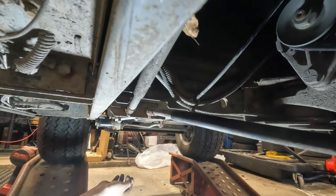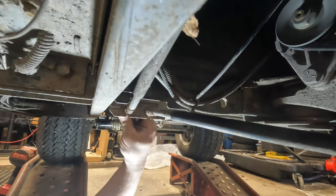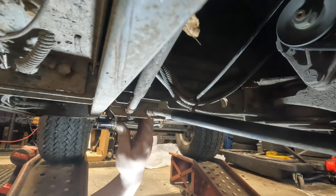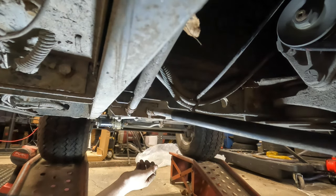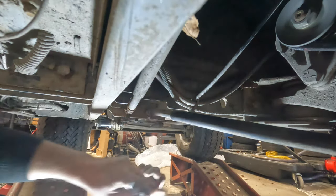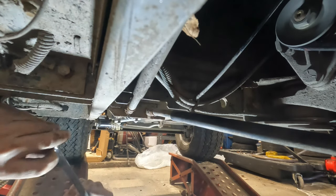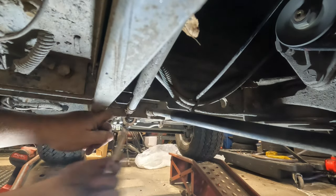A little bit of slack. The cables are not coming out yet. I'm just kind of... Okay, brakes are applied right there. Okay, so I can go a little more. There we go. Okay, and they all go all the way in like they're supposed to. Oops, I need the half inch. And now we can run in the jam nut, and then we'll lock everything down, and then the brakes are done.